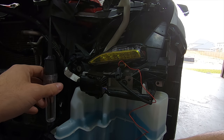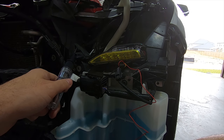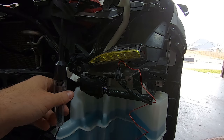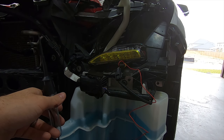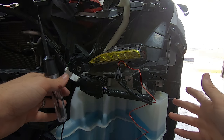There are a few ways to wire these lights in, and the method you choose depends on a few variables. First, if you already have a Diode Dynamics always-on module, then wiring both lights into the harness like SpeedCulture Studios did would probably be a good way to go, as long as you don't mind running wires from the driver's side to the passenger side of the car.